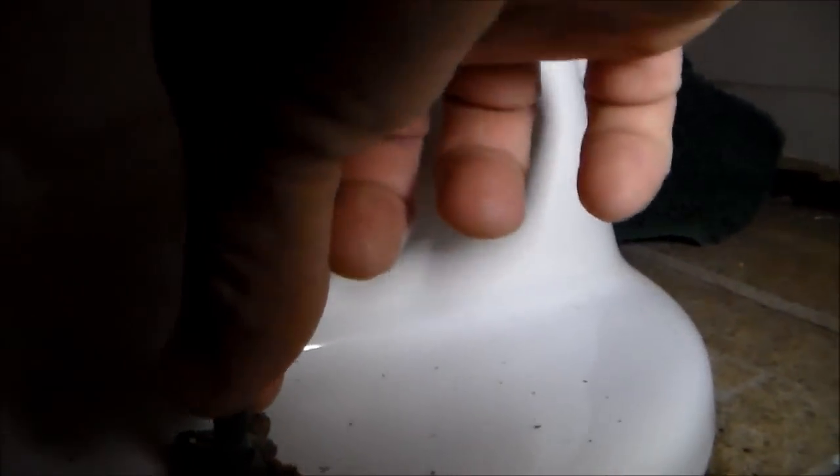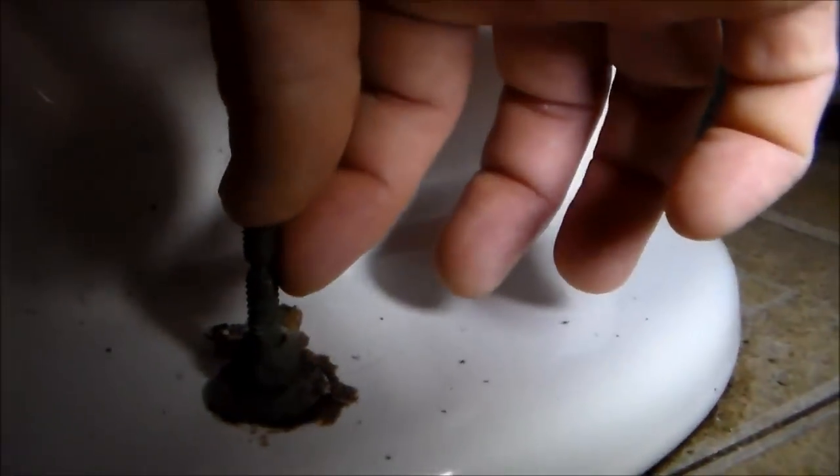Down here you can see the two bolts you're going to want to take out — one on each side. Take these bolts out. Now, see how it's real thin right there? When you buy these bolts and tighten them down, you can get plastic caps that cover them. You put your cap on, then snap that thin part off so the cap cover goes on.